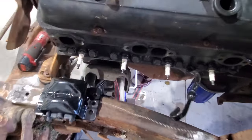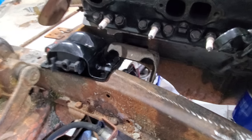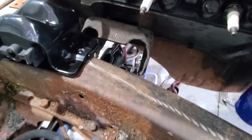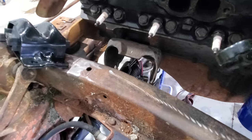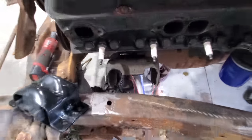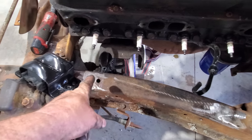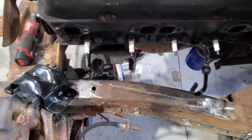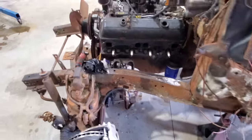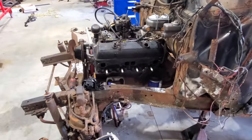Well, I got the header out of the way and got my motor mount on. I was trying to use square body motor mounts, but it's too large of an assembly. So I'm probably going to have to go with some kind of aftermarket mount too. So I reckon I'm fixing to go in the house, get on the interwebs, buy me some shorty headers, and find me some kind of motor mount that I think will work. And then I gotta get couplings and U-joints and double D shafts for the steering. Probably done for the day. I think I'm going to go to town after a while and get stuff for the back brakes. That might be what we work on tomorrow, but for now, I gotta go order some parts.